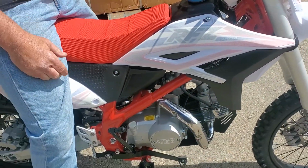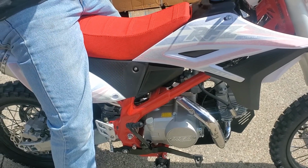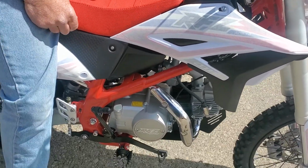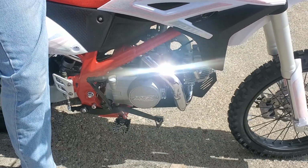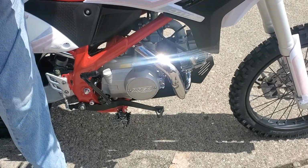So you hear the idle? That's a good idle. Yeah, it sounds good. As it breaks in, if it speeds up or slows down, you'll adjust it with the screw, just turn it to the right or left. It'll go up or down. Now, let me see your carb cleaner. If you want to clean it out a little bit, there's where it goes. You rev it up.